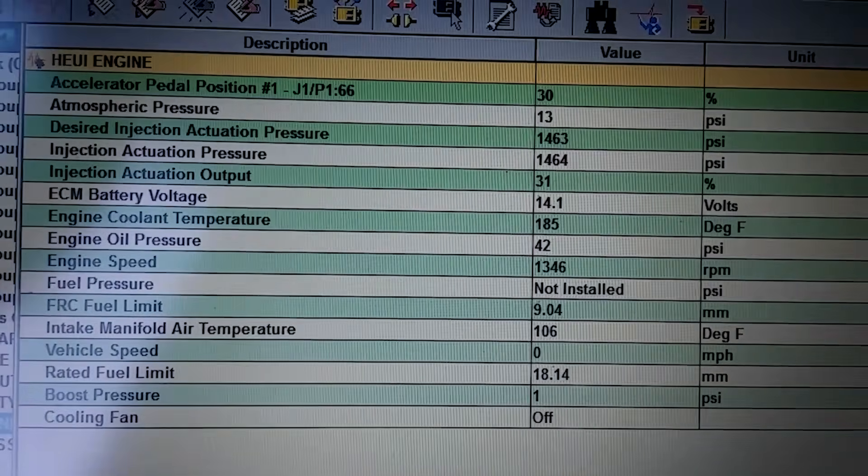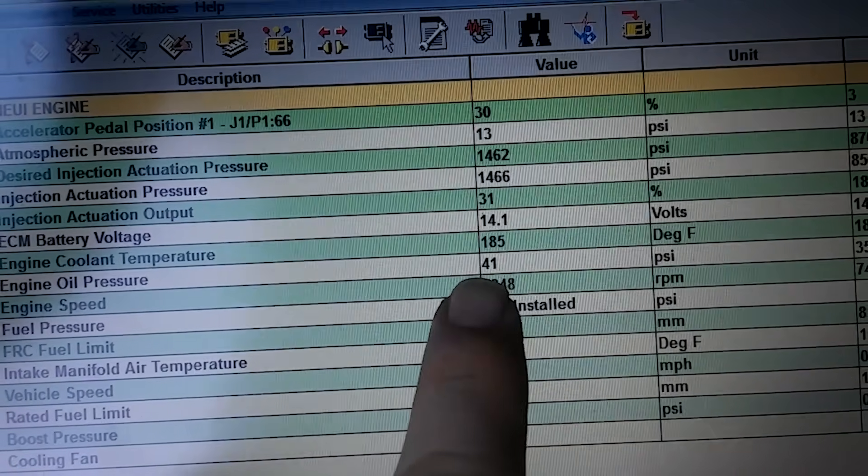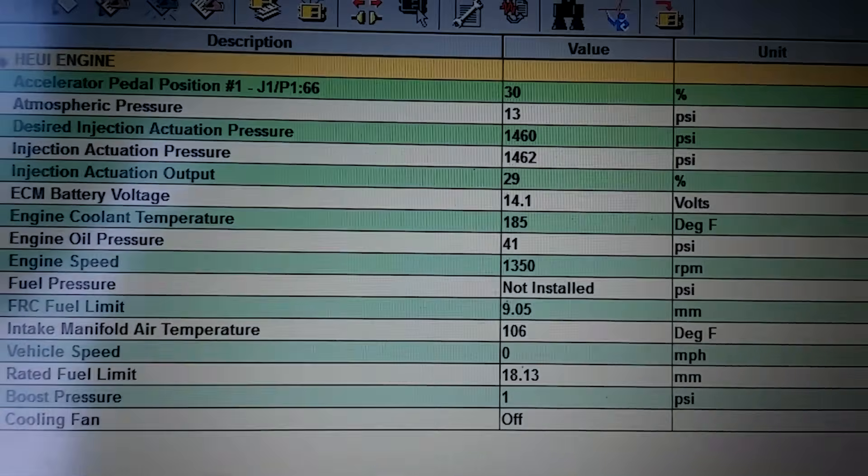Why would you want the engine to be hot? If it's a hot day outside, you as a person want to be cool. But an engine is not a person — an engine wants to run in a specific temperature range. When we say engine temperature, we're mostly talking about engine coolant temperature here, though there's also oil temperature, intake air temperature, and exhaust temperature. Mostly we're going to be discussing coolant temperature and also oil temperature. Oil temperature is typically a little bit hotter than engine coolant temperature, and it needs to be.